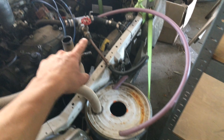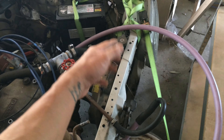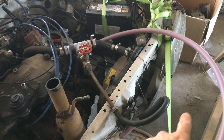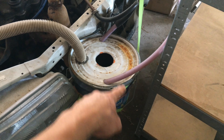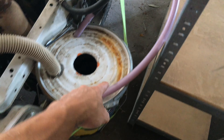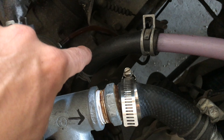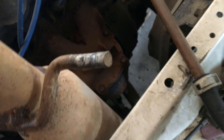The hotter you get your petrol, the better — the more vapor it produces. I'll get into the technicals of that in a moment. What I have here with these tubes — I've tapped into the coolant line. That's from the hot side. It goes in, cools down as it goes to the bottom, and then comes out. Obviously I've tapped into that with this very dodgy-looking thing, and I can adjust the flow there. What it does is it pumps hot water through this little contraption into that bucket. Inside there are about eight to ten coils all the way around along the perimeter of the bucket down to the bottom, and then comes back up from this tube, which ties in to the cold side where the intake goes into the block.